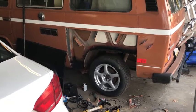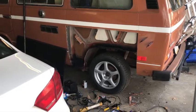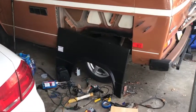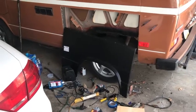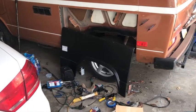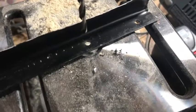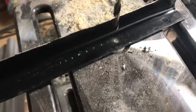I got all the sides ground out and everything cleaned up. I think I did a pretty good job of eyeballing where to cut for the panel, so I'm going to try to put it on. I'm going to put a little bracket along that shelf area just so the panel has something to glue to, because it's really just a thin piece of metal.